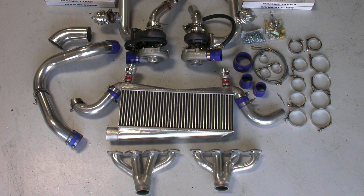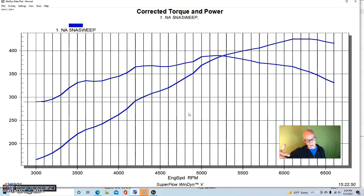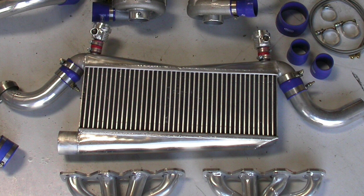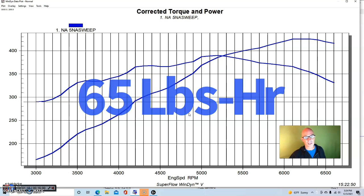Here's what happened after we added our turbo setup. This was a twin turbo setup from the guys at HP Performance — it had twin 57mm turbos, and these were mounted up by the bumper area. It had a front-mounted air-to-air intercooler on it. We had big injectors — this thing had 65 or 75 pound injectors in it.